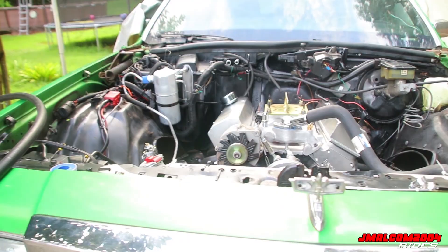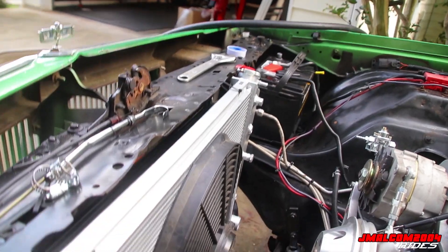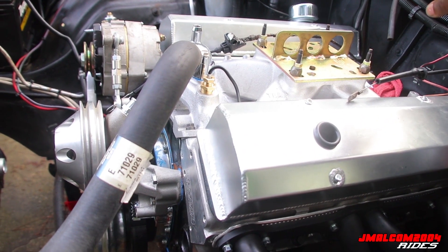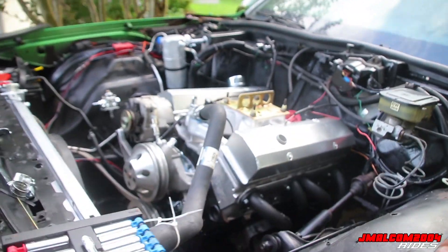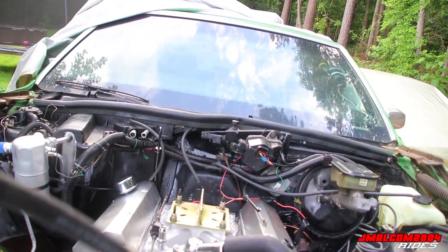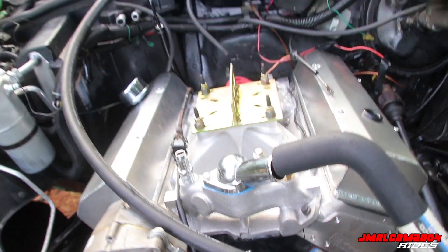The day's not over — it's still the same day. Sun ended up coming out, so I'm about to make the most of it and do a little small stuff — the stuff I can do quick. I got everything out, I'm going to go ahead and put the oil stick in. I could have set it top dead center but little stuff like this — I'm about to Teflon tape this so I can put the heater hose fitting on. I only got one heater hose fitting, so I'm going to put that on and run it to the water pump for now.